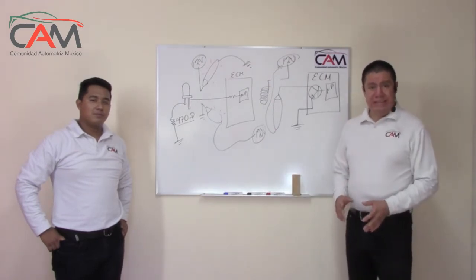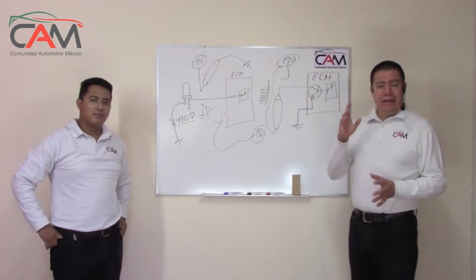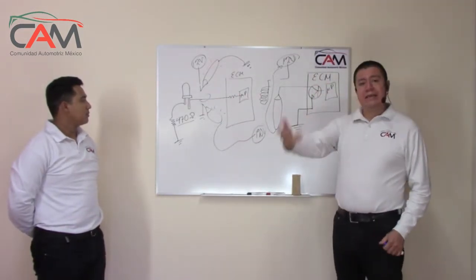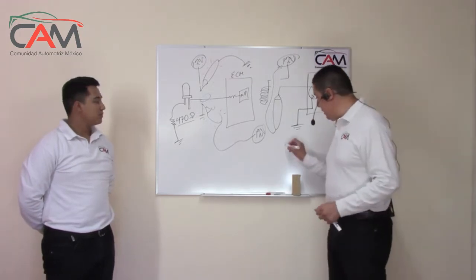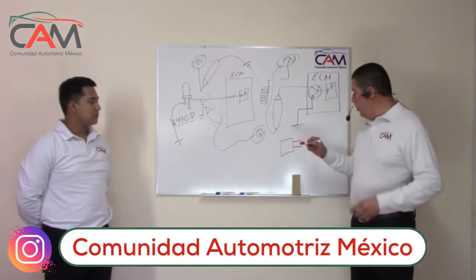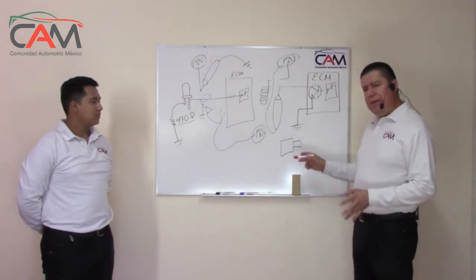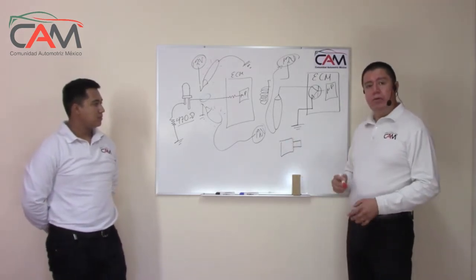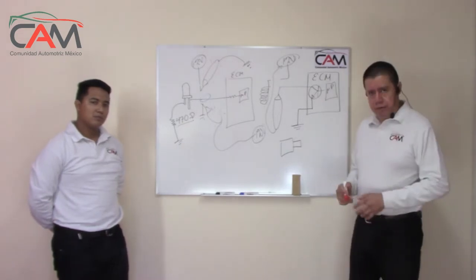Now we will perform an ionization test directly on coils in a vehicle. For this test it is essential to have a high-resolution oscilloscope wired as follows: one channel is mounted on the line that generates the saturation of the power transistor. The other probe is passed around the top of the coil — the resin-covered section — moving the probe tip to obtain the largest possible signal to verify timing. We are not trying to measure a voltage level here, since the probe is not electrically connected to anything; rather it captures an electromagnetic signal and gives us a waveform.